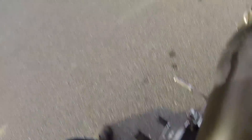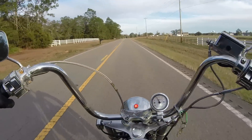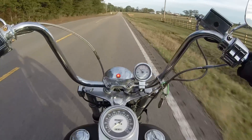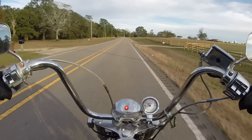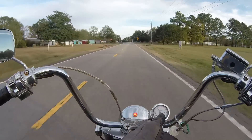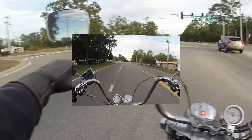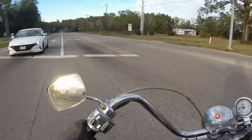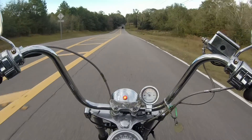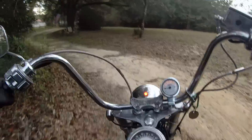Let's see if we can hear those clutches — oh yeah, so much better! When I would take off from first, this thing would act like I was dumping the clutch — just boom like that. I guess that's part of having old bikes. The valves are clattering and the bottom end just has too much of a load with this sprocket. I think 51 teeth on the back is the right call — why do I want 70 miles an hour on this thing anyway with crappy brakes?